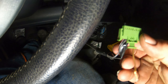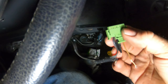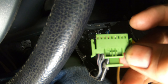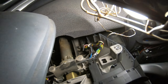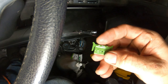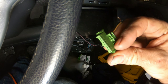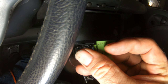When it goes into the back of the gauge pod it's like that with the tab up. If you look on the tab-up side you see all the pins in there. If you count from the right side over: one, two, three, four — that's the same connection as this wire under the gauge pod. So if the gauge you have doesn't have that single wire, from the right side: one, two, three, four, five, six — that's the pin it needs to be plugged into.